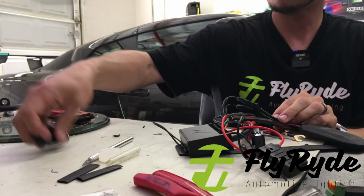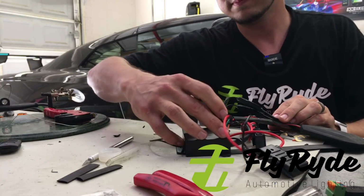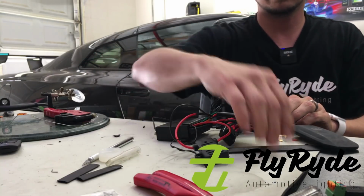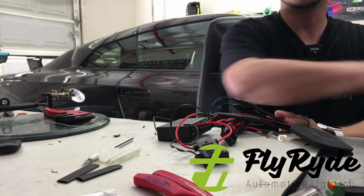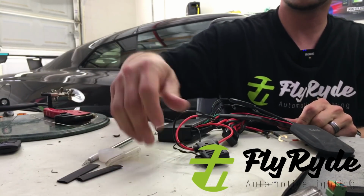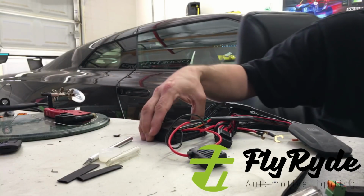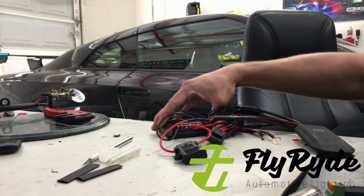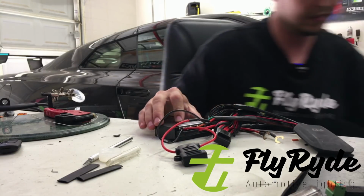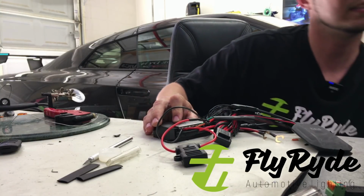So to finish up that thought, because I'm all over the place. If you have a patch harness, like for a GTR or WRX, and you make a bunch of crazy changes, and then you decide later that you want to unplug that or undo it, you can quickly change back to stock without all the downside of having hardwired everything into the car. I speak from the experience of having done a lot of hardwiring directly into the car. It sucks. It's not fun at all.